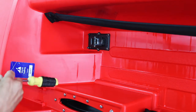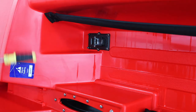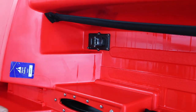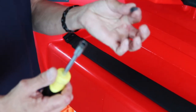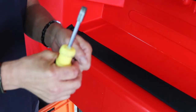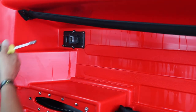Just a tip here: for this first one you need to get the screw to yourself, so I'm going to push on here. Stuart is going to spin the screw out and then pass it over to me, and I'll explain why. You can see here I've got the 8mm socket but the nut has sunk down, so you need this screw which we've just taken out to put in there and remove it — just makes life so much easier. Keep them there and then we'll go round.